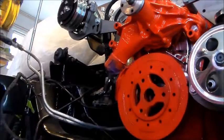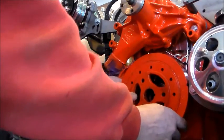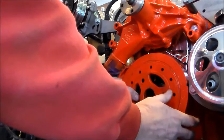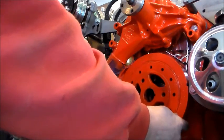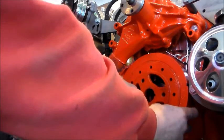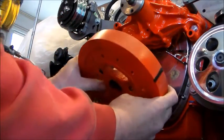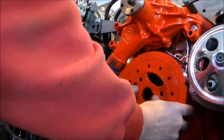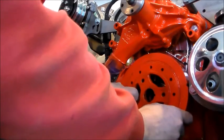The reason I'm changing this particular balancer is I have a unique situation — my balancer is loose. I'm doing this engine for a guy; the engine was all assembled and I'm putting it in the car. I noticed that my harmonic balancer has a little bit of walk to it, so I grab hold of the balancer and boom, it comes right off. There should be an interference fit — this should literally be pressed on here.